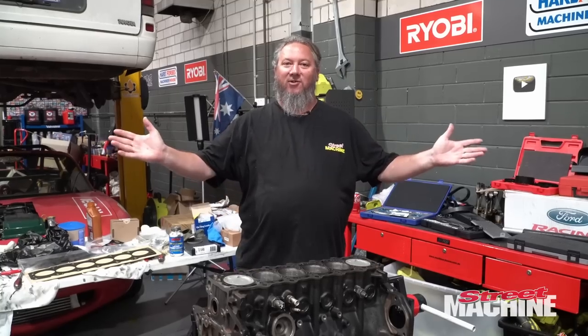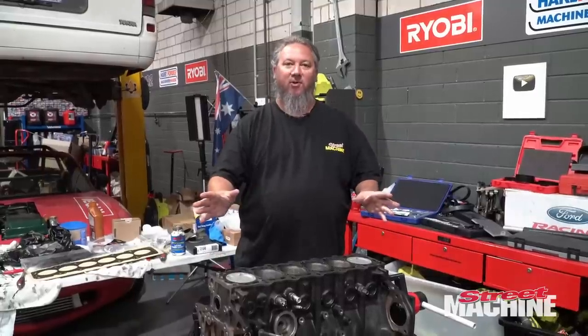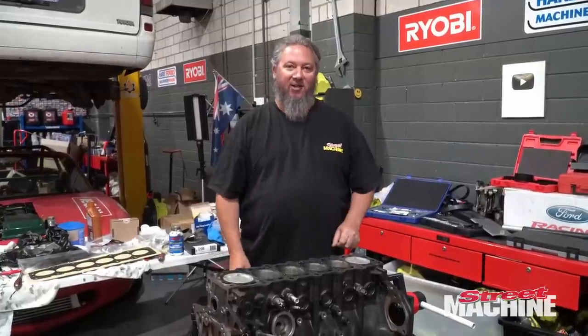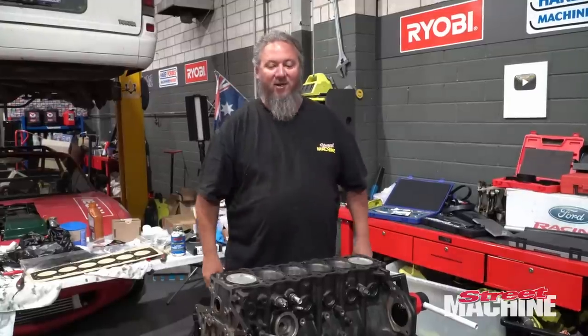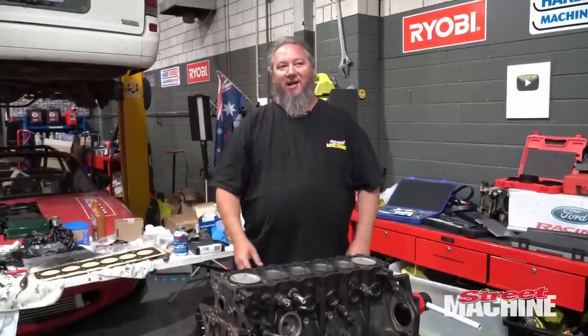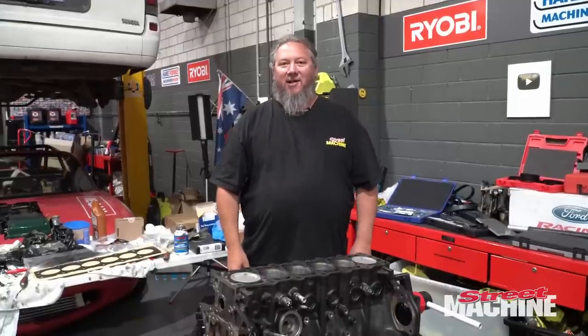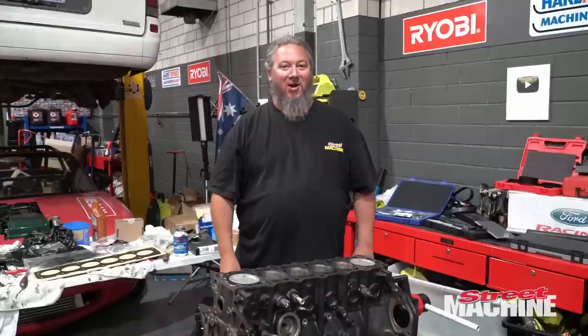And it's a brand new day. We have our rods, pistons, crank, all in our 2JZ block. And now we're gonna get down to the nitty gritty of what's involved in making this a 1.5JZ, right? So a 1JZ head on a 2JZ block. Now, you might imagine that it's pretty simple, just bolt head to block, but no.